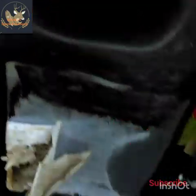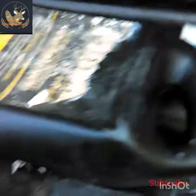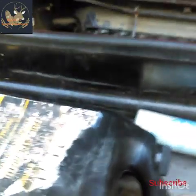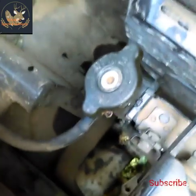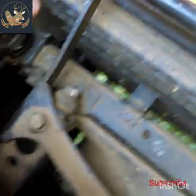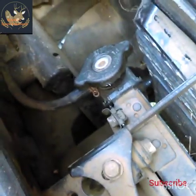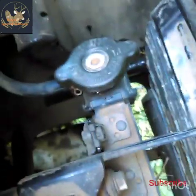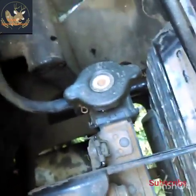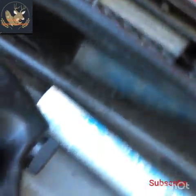I always keep some water in here — somebody gave this to us when we broke down riding dirt roads back behind our house. Whatever you do, if you're riding and you overheat, do not touch that and open it right after the thing turns red. You can touch it, but make sure you've got a towel. I would wait at least 30 minutes, because if you open it right when you stop, water is going to spew out everywhere — it's boiling and hot and it will burn your skin.